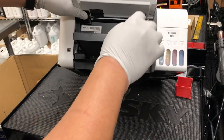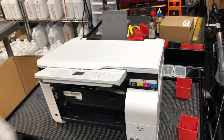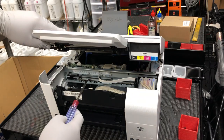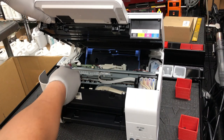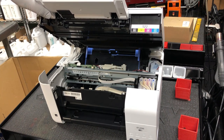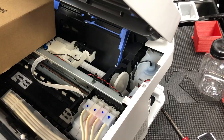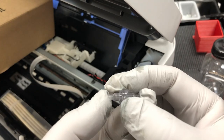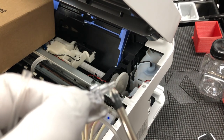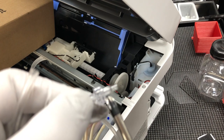We need to remove two screws — this screw here and this screw here — then we can lift up the scanner. Slowly lift it up. If you lift it too high, you're going to pull those two cables out of the motherboard. To put them back is not hard, but we don't have to if we don't need to. Put a box here to keep the scanner unit open. Take out the conversion kit. For the connector, it has two sections — one connects to a smaller tube and the other section connects to a bigger tube.